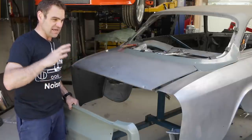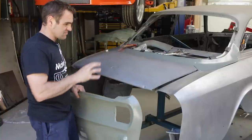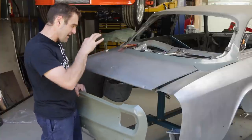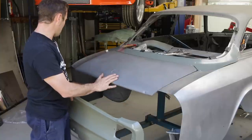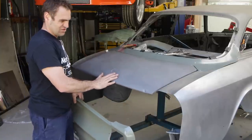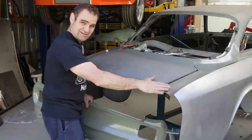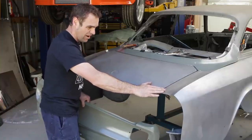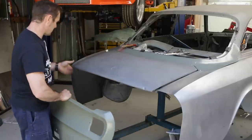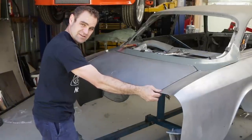It's amazing how much time gets sucked up just trying to fudge things backwards and forwards to make them line up. But we're getting there. Now I've got the boot lid trying to line it up with the rear quarter panels — this side seems to sit reasonably nicely, although maybe a little bit high, and this side sits a little bit low. So it's a matter of tweaking them to get them to sit nicely.